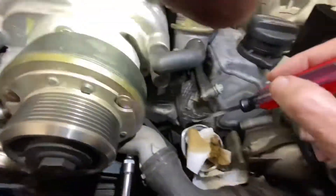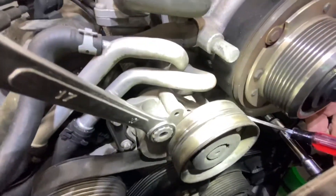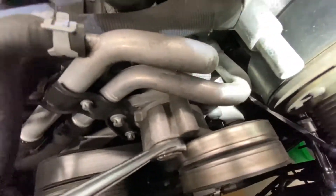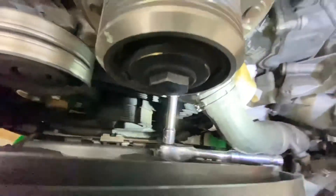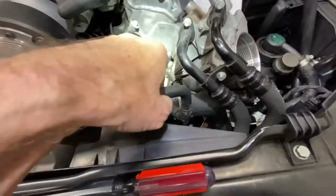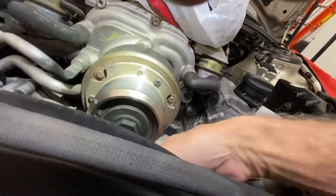What I've discovered is that even though there are tons of bolts, there appear to be two that actually hold it in. The first one is here — there's an E-torx right there, you can see it. I'm trying to get the camera to show where it is. There's one bolt, and then you can see the socket going here. So there are two bolts that hold it on. This hose goes to the overflow tank, which is right there.